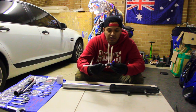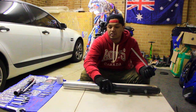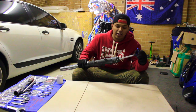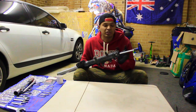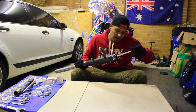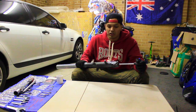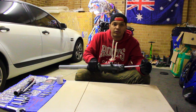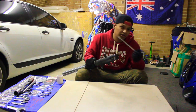Second thing you're going to need is a 10mm long Allen key, because there's a bolt underneath this fork over here, so you need to reach it, and a normal Allen key will not help. It's too much of a distance to reach in there, and remember that Allen key is a flat head Allen key, so you can grip that properly so it doesn't slip when you're trying to undo this. You probably need to put this in a clamp as well to hold the fork down while you're trying to undo it, with an extension to this T-bar, or the T-Allen key.